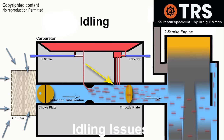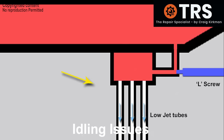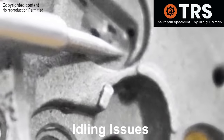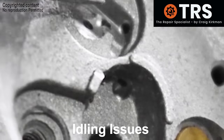So what can go wrong in the carburetor to stop this system from working correctly? Just like the high jet, we've got a screw to make adjustments to the amount of fuel emitting from the low jet, but the way the jetting works is slightly different, especially in its tubular structures. The low jet system has its own small fuel reservoir, where under normal working conditions the suction pressure from the venturi below draws the fuel down out of the metering reservoir through the low jet fuel hole and fills the reservoir. Right next to the low jet fuel hole there is a core plug or Welsh plug, and underneath that Welsh plug is this compartment. The fuel has gone down the low jet fuel hole, through the fuel way, out through the small hole in the corner where it comes in and floods the compartment.